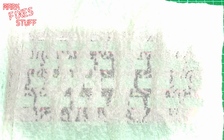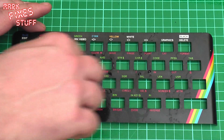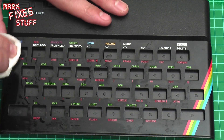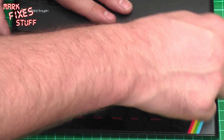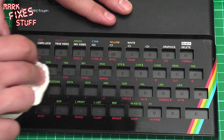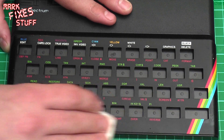Whilst you've got the faceplate off, give it a wipe - without the keys poking through it'll be a lot easier to do. The way I like to do it is put a bit of kitchen towel over the top and then saturate it with a cleaning solution - this is just antibacterial, it was to hand. Then very, very gently remove that and just give it a little wipe over the top. If you're really worried about deforming the faceplate, a good tip is to take your Spectrum top shell and pop it on top - the sides actually hold it. Just don't push too hard. I'm not going to bore you with putting this all back together because it's just the same in reverse with a bit of double-sided tape. This is Mark from Mark Fixes Stuff signing out and reminding you to subscribe to get your fix. See you all in the next exciting episode.